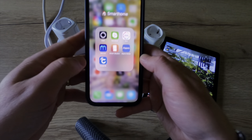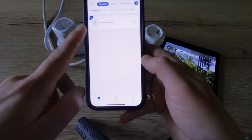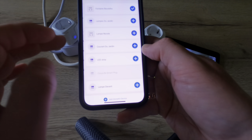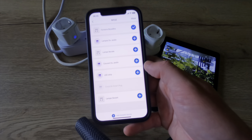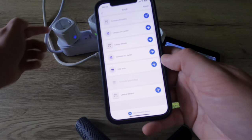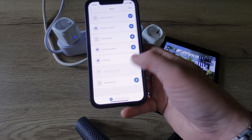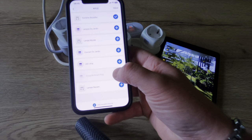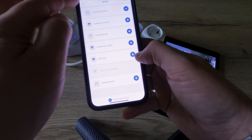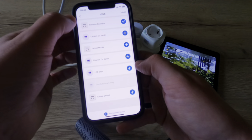I've downloaded the CozyLife application. I already have one smart plug I've used for almost a year. I can show you how to add new devices — you go to your profile, then HomeKit, and you see all devices within your HomeKit environment. My new smart plug is greyed out; I try to add it again by scanning the HomeKit code and it says it is already added. I can't make it work or refresh. So the only way to make it visible would be to delete it from the HomeKit environment and add it again. The settings are exactly the same as in my other smart plug so I will show it from there.